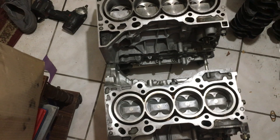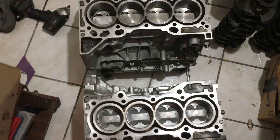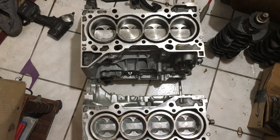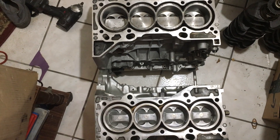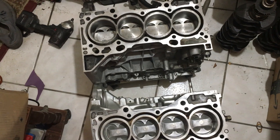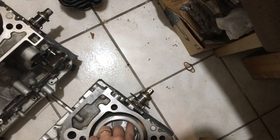We'll start with the head gaskets, but first let's go over here and take a quick look at these blocks — a K20A3 block and a K24A block. You're going to see that there are a whole lot of similarities. It's kind of like the B-series situation where the blocks are virtually the same, just bored over a millimeter: 86mm bore for the stock K20s and 87mm for the stock K24.